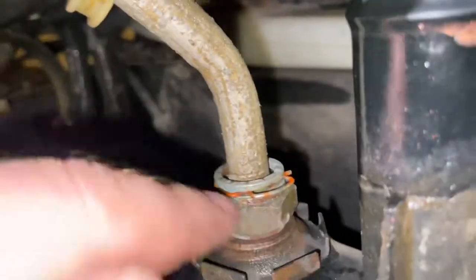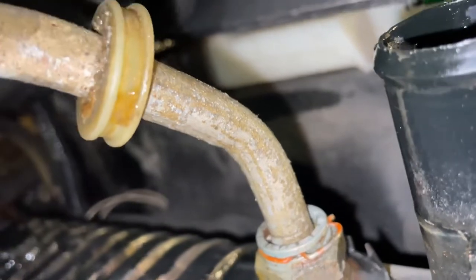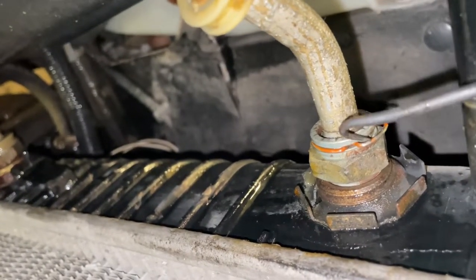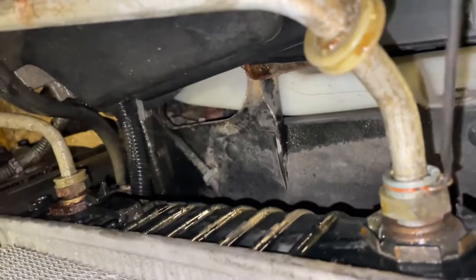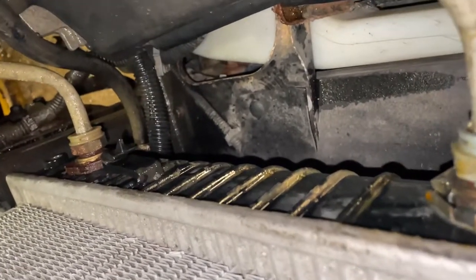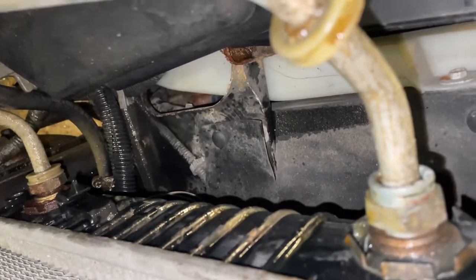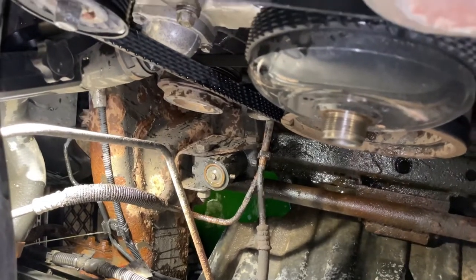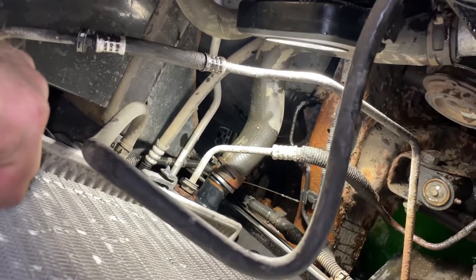Here we go — here's our oil cooler line clip. I grabbed this little tail with my pick to pull it out, then started filming to show you guys. And there it goes flying — that's why I want my other hand actually on the back of that clip so it doesn't go flying. I think it went into the coolant bucket, but our new radiator has new clips. They don't always come with new clips, so be careful. We're going to get these lines off and then get this radiator out of here.